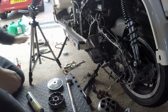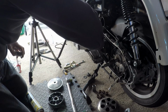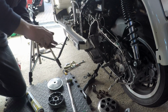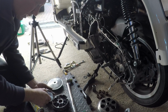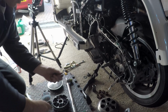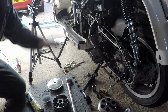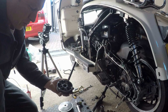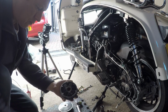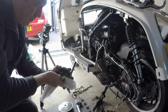Right, our sliders. Oh, while I'm messing about, put that dipstick in. Dr Pulley Sliders, black pearl sliders. These come with a 2mm washer, very important. We don't want that belt sliding too far up and off the roller. Before we put the rollers in, just give that a really good clean inside. And the boss.